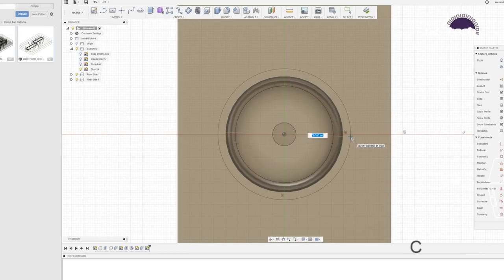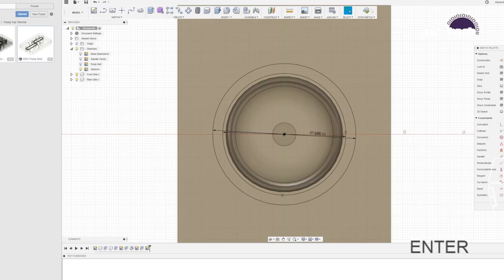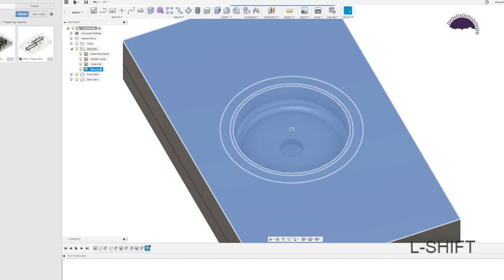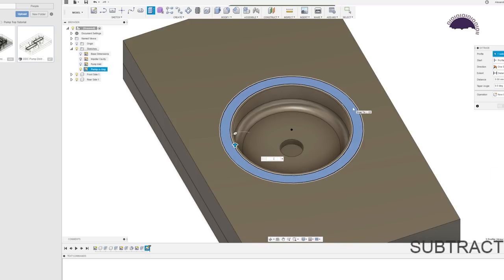Unlike the DDC, we're going to have to add an o-ring groove, so new sketch from the center. The internal diameter is 52.5 millimeters and the external is 60.5 millimeters. Make sure you do measure your o-rings — not all o-rings that come with pump tops are the same size. You can't go wrong if you simply measure them. These measurements work well for Thermaltake and EK units, but double-check for other manufacturers. You can also buy o-rings separately as they're fairly standard sizes. Stop sketch, name it 'pump o-ring,' extrude minus 2.4 millimeters.